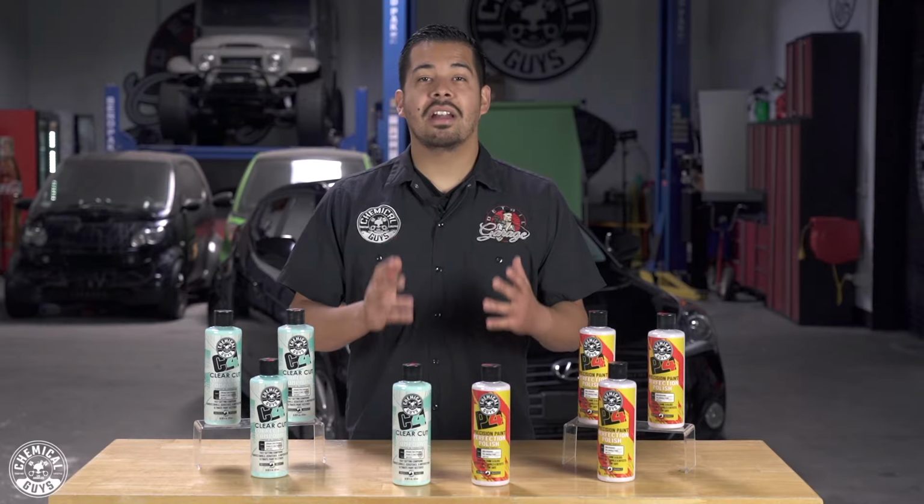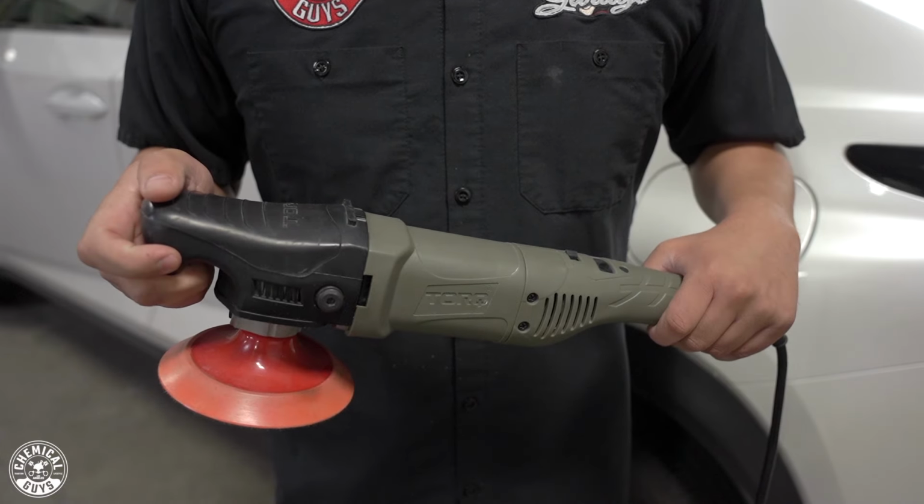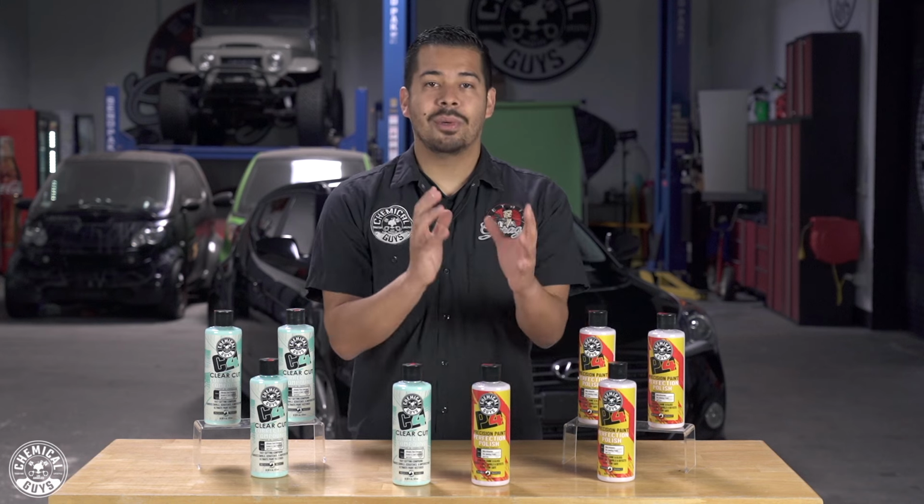And for you guys out there that utilize the wet sanding method for paint correction, you can actually use C4 to remove 1200 grit sanding marks and above. It also contains no oils or micro swirl fillers. You can use C4 with your favorite dual action polisher, rotary polisher, or you can even use it by hand and achieve incredible results. And now moving on to P4.